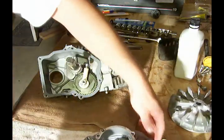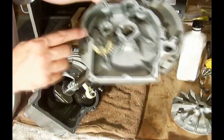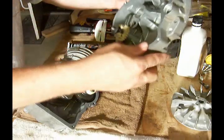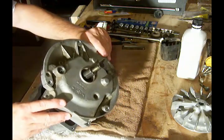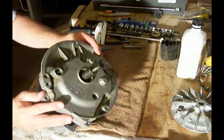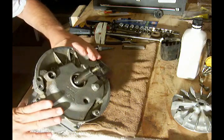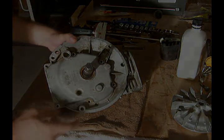We also want to put a little grease around the crankshaft. Now the tricky part is to get the crank cover on — these knobs here are going to fit into a couple of holes. We've got to make sure that the oil slinger, the ball on the end, fits in there. So a lot of things have to line up here. And there we go — crankcase is put on. Now we will bolt it up.